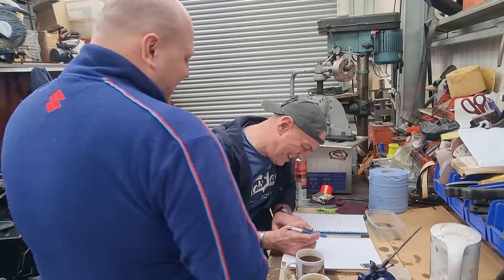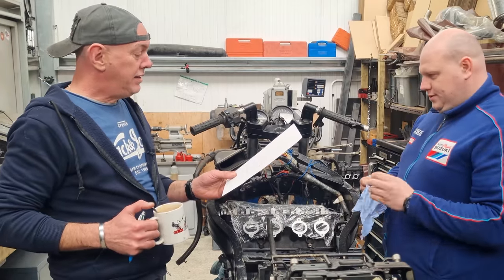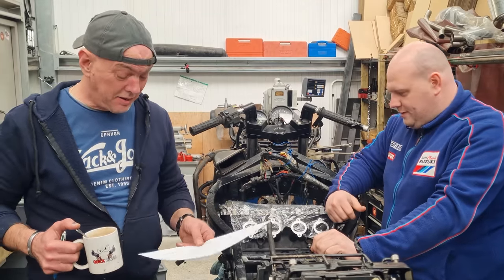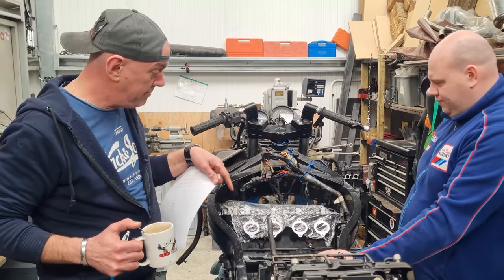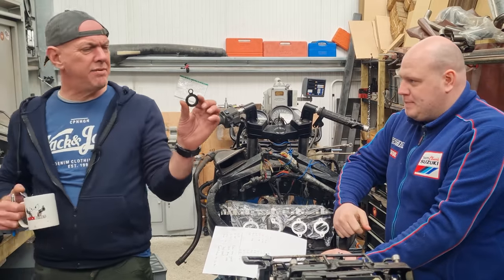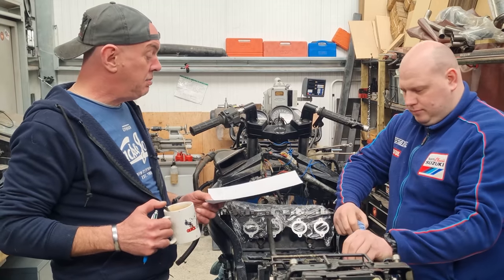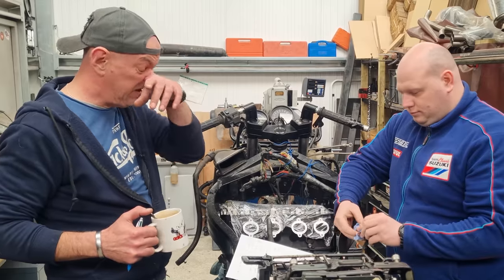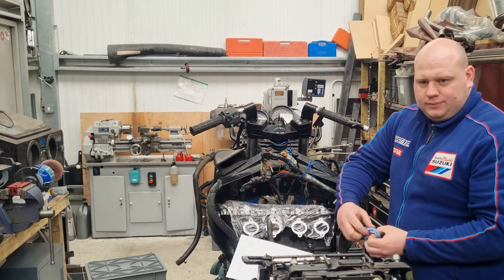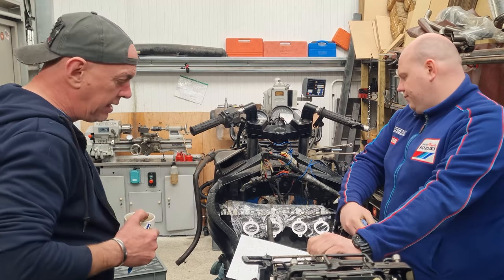All those exhaust ones are okay. I've got a list of shims I need - lots of numbers, I won't read them all out. Other stuff I need is a valve cover gasket. In the valve cover there are also little seals that go around the spark plugs - I need some of those too. Sump gasket - I've got one coming, it's not here yet, so I'll just go down the bike shop and get one. And on the carbs there's an O-ring that sits in the groove just to seal it up to the air box - I need some of those as well.